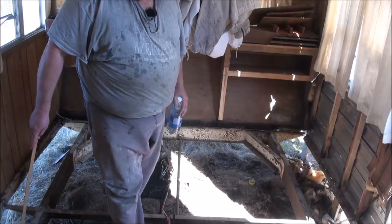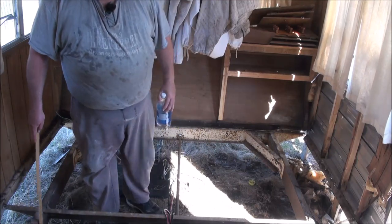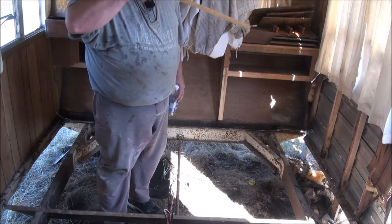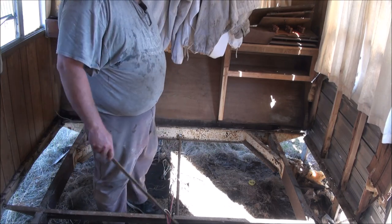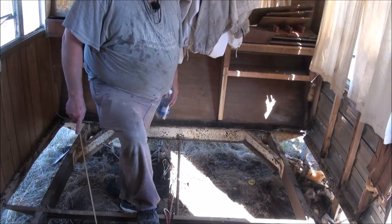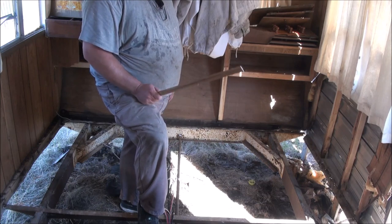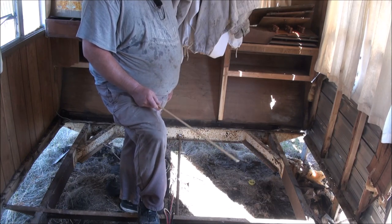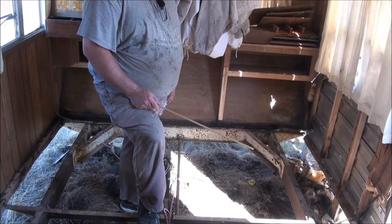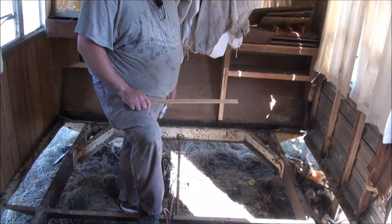These frame rails, of course, it's just a trailer, right? So these frame rails across here, they sure are wide. And there's nothing in the middle to support anything. These cross members really are not very strong. And actually, every time I walk into my camper, I could hear a squeak. I thought, oh, maybe one of these cross members broke loose. I'm going to have to re-weld it. Well, it didn't. Just that when you step on these, they twist real bad.